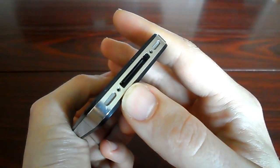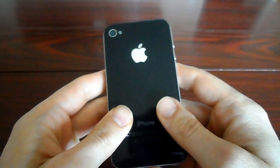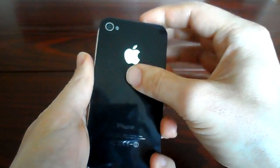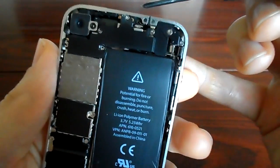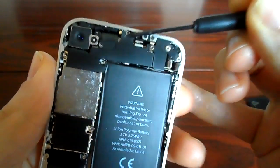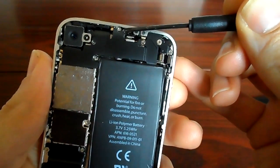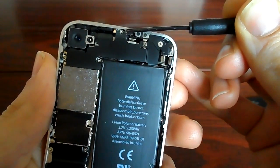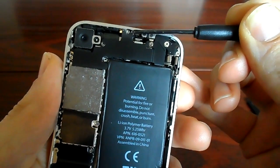First, let me turn off my iPhone. The first thing you need to do is remove the two screws on the bottom of your iPhone — which as you can see I've already done — and then you slide off the backplate. I'm using an iPhone 4, and there is a screw on the top of your iPhone right here that you need to make sure is tightened really tight, because this screw is connected to the Wi-Fi flex cable, and if it's loose it can affect your connectivity to a wireless network.